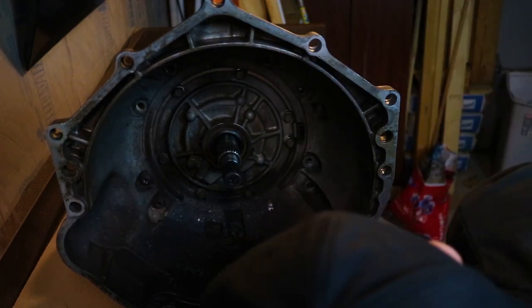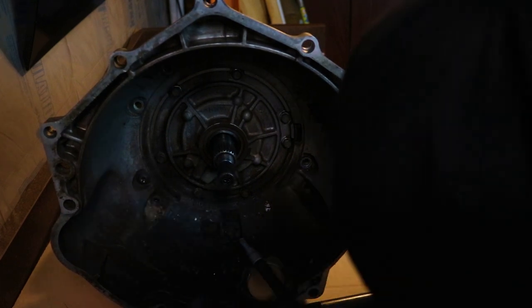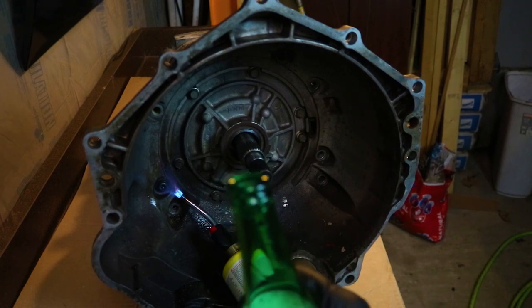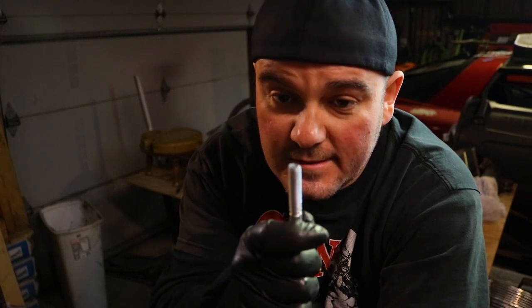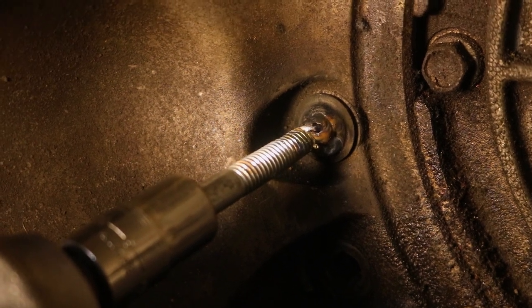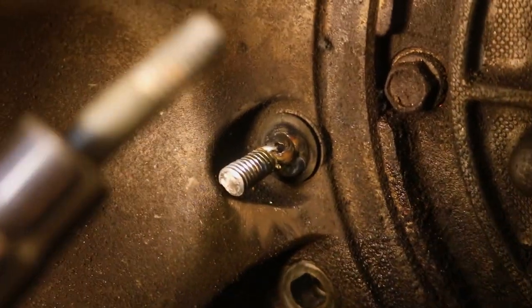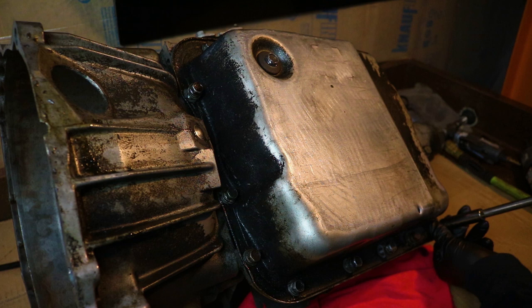Well, that bolt is just destroyed — just the one. I have to do some magic tricks here. That is just destroyed, I am so screwed. I've got two options: either grind on that bolt head, or take a grade 8 bolt, grind it down a little bit, jam it in there, and weld it on. It is what it is. I guess I've got to go out and get some grade 8 bolts.